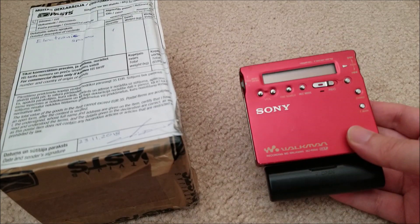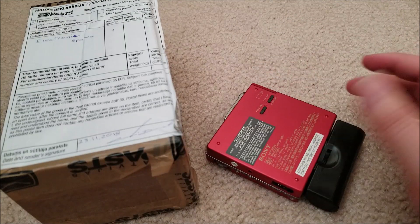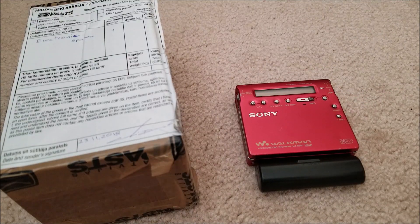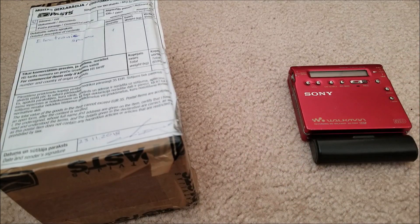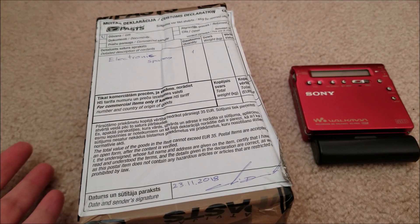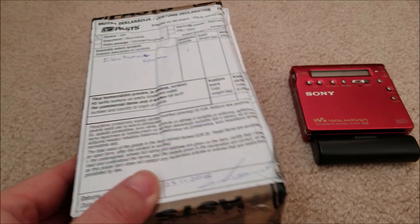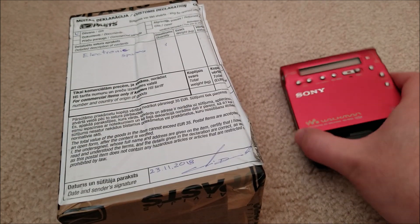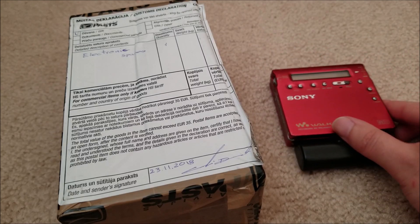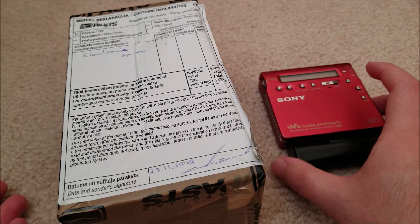Unfortunately, even though it's pretty much just the lens mechanism failing, the laser diode itself is just fine. It'll start up any disc quickly if you put it upside down, which is a shame since you can't just replace the lens and electromagnet. Anyway, I mentioned that and my friend Guntis — hopefully I'm pronouncing his name correctly — messaged me and said he actually has a spare lens and would I want one to do a replacement video. I thought any spares would be impossible to find since this device is well over 10 years old, probably 15 to 20, coming out in the late 90s or early 2000s.